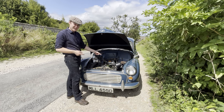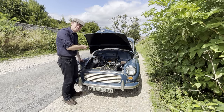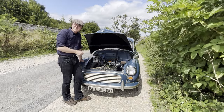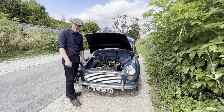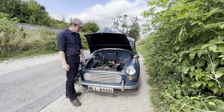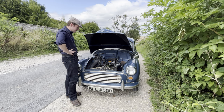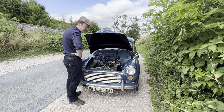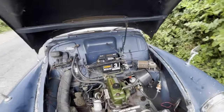If you're negative earth like most cars — actually this one is positive earth, so the power feed is the negative terminal, which makes sense. Basically power from the battery to the coil is all you need, and on this car you've got a starting handle so you can wang it over and it'll go. Random bits of wire kicking around is good. I haven't tried starting this on the handle for a while — it's warm so it's cheating, but I might do it in a minute.